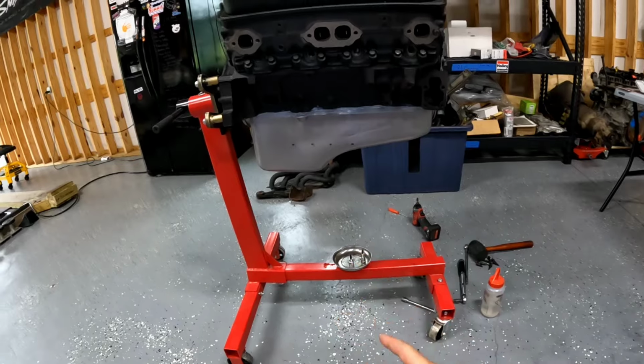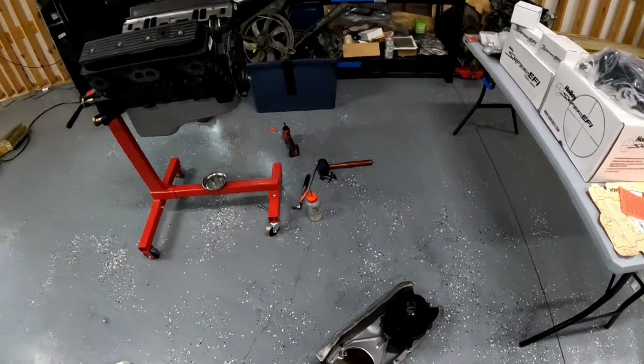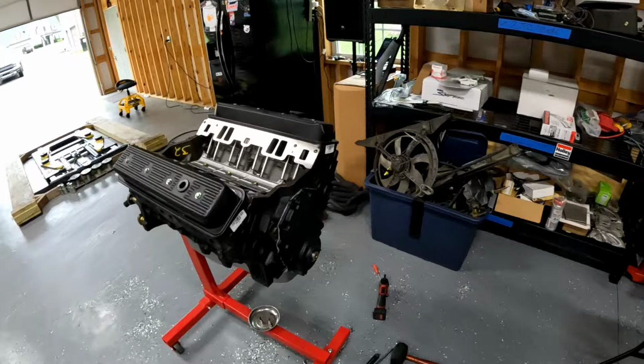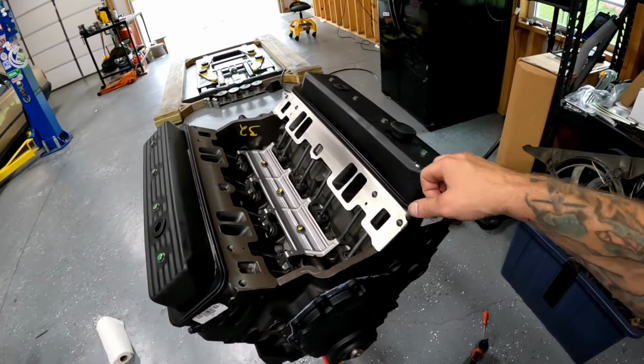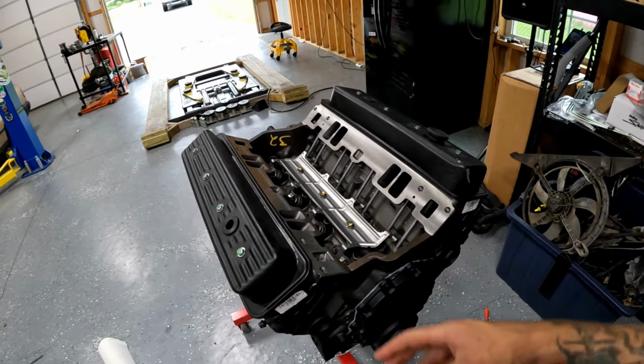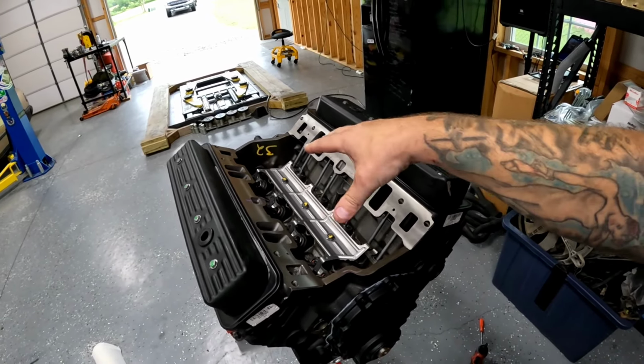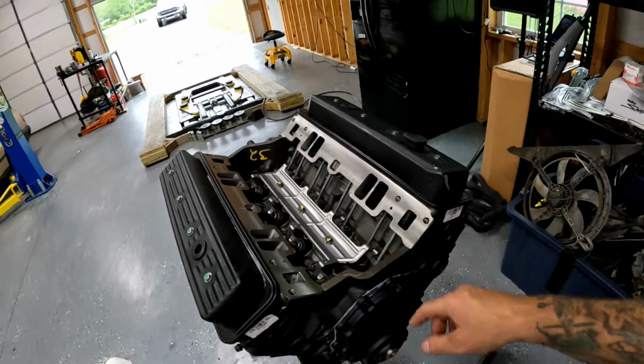New oil pan. And so these parts are trash. Next thing we're gonna do is pop these valve covers off. Make sure that you really can't trust these crate engines, so you wanna inspect the valve train when you get them. And it makes dropping the intake easier so you don't get hung up on the valve covers.